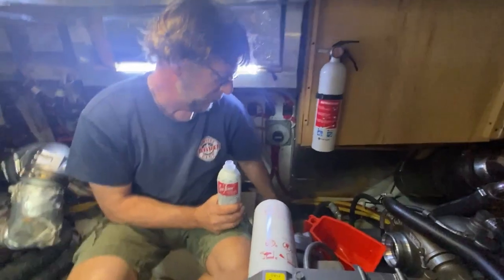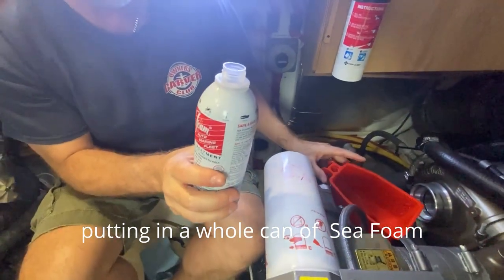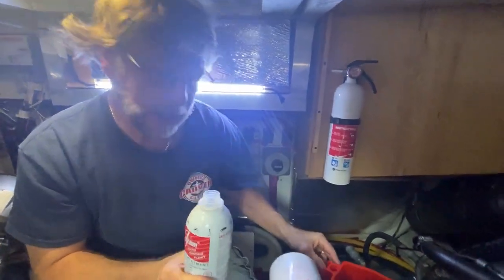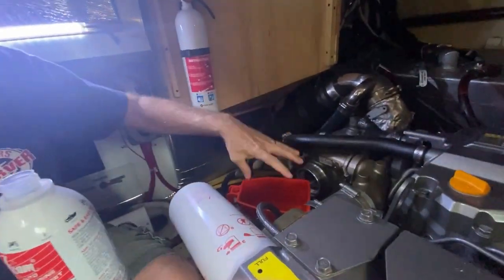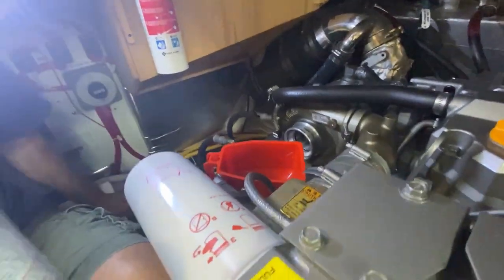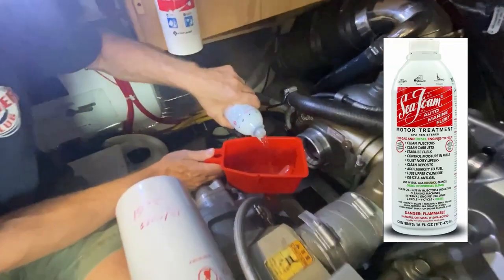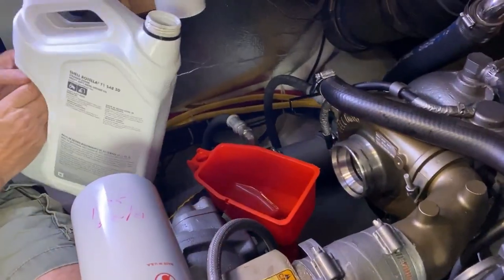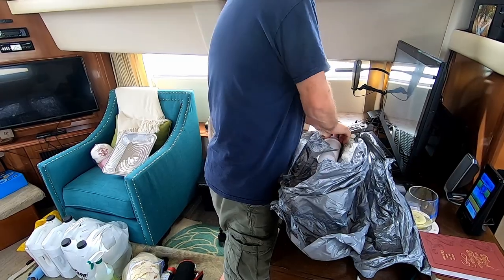I've got the transmission drained all the way down through the pump because I couldn't get the drain plug out from behind the flange on the drive shaft. So I'm going to put in some Seafoam — it's a good treatment in general. I'm going to put the whole can in just to help take care of any water in there. The commercial says it kind of gathers the water all together. Then I'll fill it with fresh oil, run it for a little while, drain it again at least once maybe twice, before I put in the new fresh oil. I'm going to fill it with oil and let it sit while I wait for UPS to come with the oil cooler.